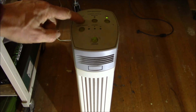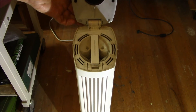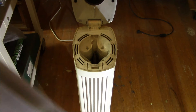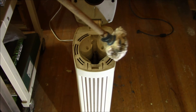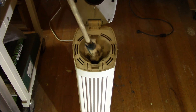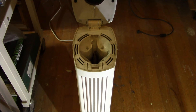I've been trying to figure out what's wrong with this. What I suspect is there's some arcing going on. I've cleaned this — you take it out and basically just wash it in the sink with a little bit of soap. I also made a little cleaning device to run down and clean off the corona wire, similar to what you do in a laser printer, and I've blown this out with my air compressor. I think it's fairly well cleaned.